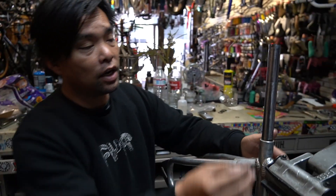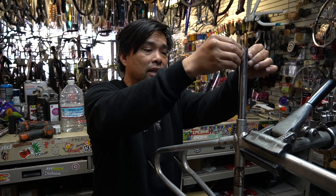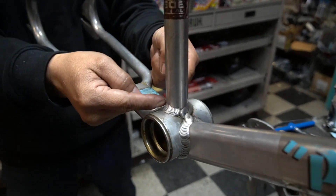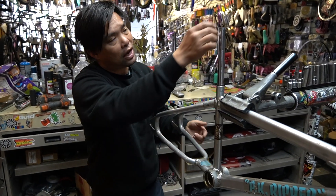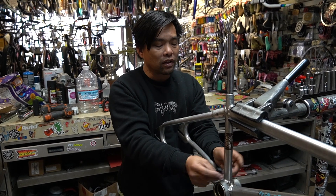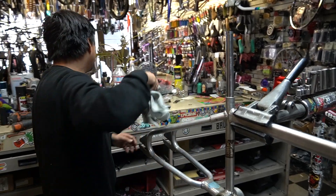What's causing this to stick is, a lot of times, whoever had this put it down too far. Down here when they ream the frames, they don't go all the way down. So the seat post goes all the way down, gets real small, and gets wedged. That's one of the first culprits. I'm gonna let that sit for a little bit.